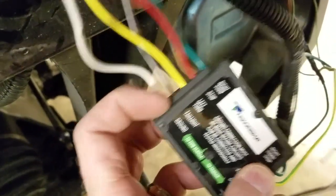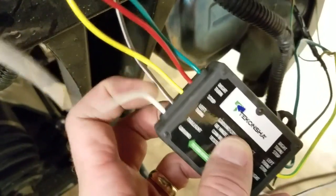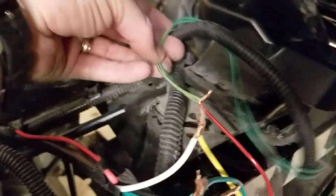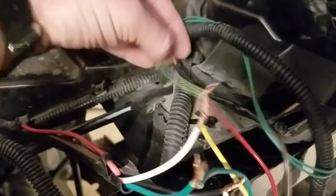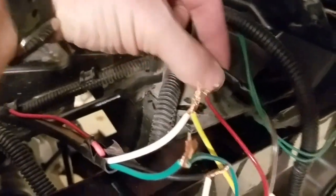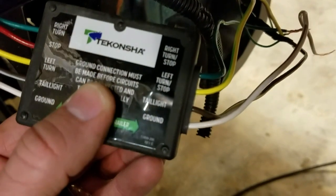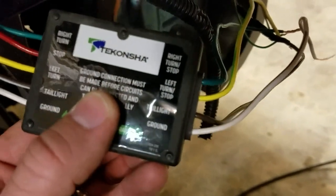And then our turn signal inputs, you have to ground it, and then your tail lights, what they mean by that is your parking lights. So it's the light brown wires. So once again, spliced it in the input, the two light brown wires, I just put them together into the input. And on your output side, you've got your right turn signal / stop light.